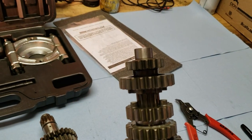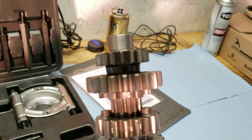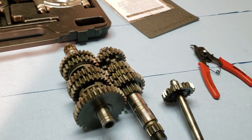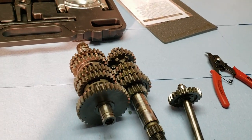For the drive axle, you're going to need a puller of some sort. I'm going to be using this bearing puller to pull off the reverse pinion, because it is pressed on there, and to get it back on I'm going to be using this press. So just keep that in mind whenever you're going to tear this apart — you're going to need something to pull off that reverse pinion and press it back on.